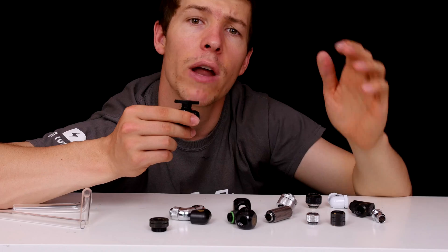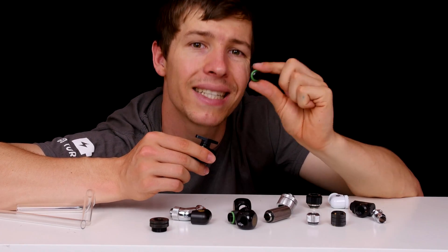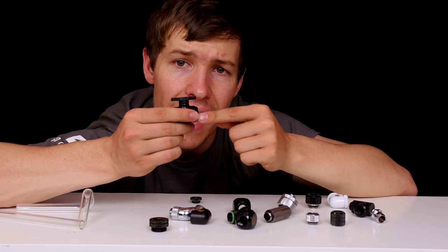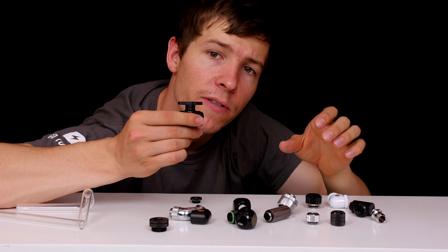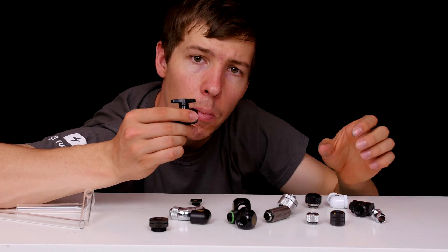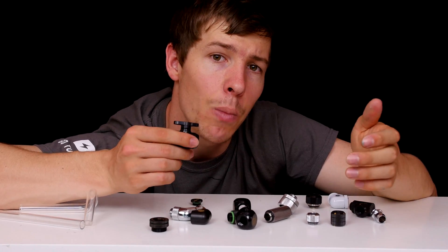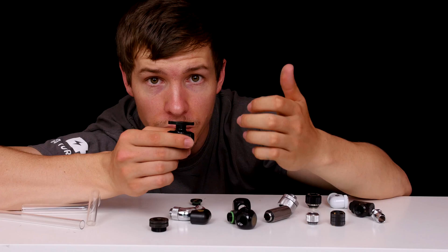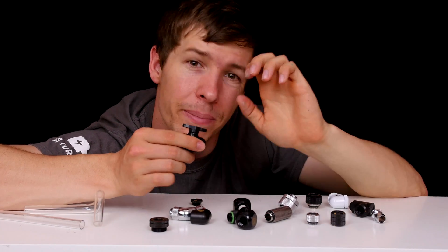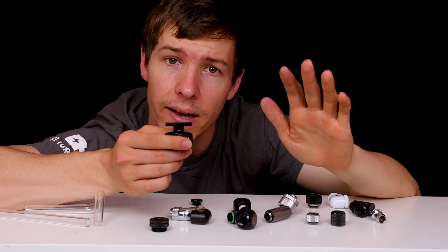When draining, not all liquid will come out quickly because the liquid needs something to replace it in the reservoir — you can't have liquid fall out with nothing replacing it. Reservoirs with fill ports at the top are handy here. Attach your soft tube, open the valve, then remove one of the top ports from the reservoir and the liquid will flow much faster because air is replacing it. It works exactly like the straw trick — plug the top of a straw with your thumb, water stays in; let go, water falls out.